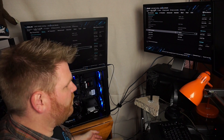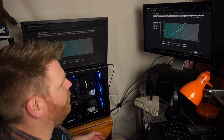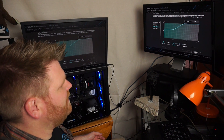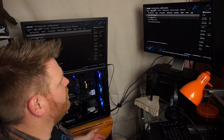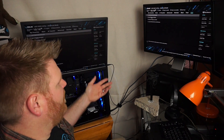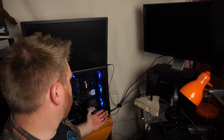Our fans are all working. So let's go into my QFan control here and set our curves down — I'm going to keep the CPU fan at turbo, but we'll put the chassis fans down to standard. What that should do is make it so that the fans don't idle quite as hard and don't kick in quite as fast, because I've got so many more of them and there's much better airflow in this case. That fan profile was actually something I haven't really touched since my old case. Everything's working and I don't see this being a problem.